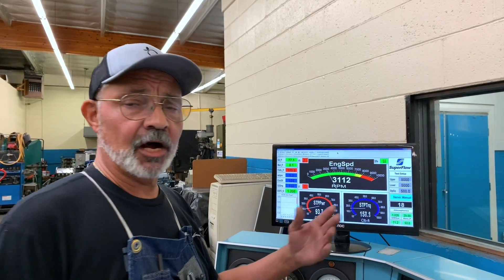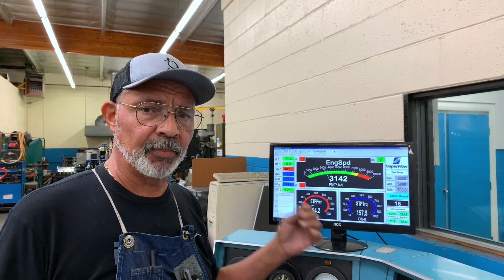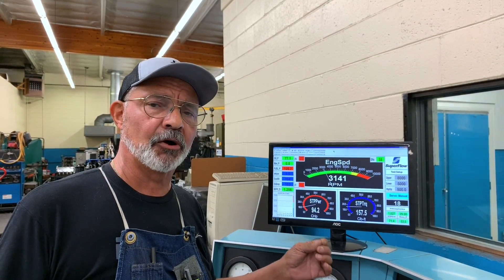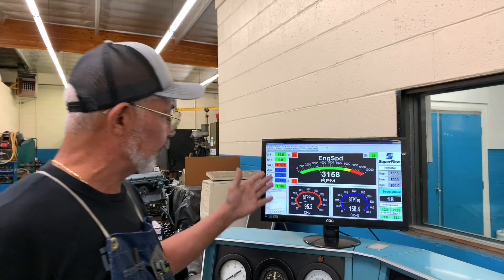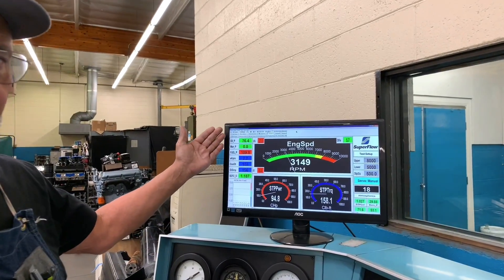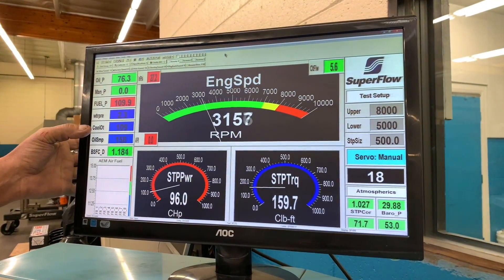All right, so Don, let's go to the Dyno Cell control panel and actually walk through the procedure of how we're going to break in this engine. Now that we have the engine running, I've gone in, I've checked the timing, which is good. And I've cut the fuel down at the fuel valve on the engine so that we're not dumping a bunch of fuel — there's just enough fuel at the motor right now to keep it running. And this is the proper way to break in an engine, especially when we're running on alcohol. So what I'm looking at here is I'm watching all my particulars for the engine: the oil pressure, the amount of water flowing through the engine, and my load and temperature right here.